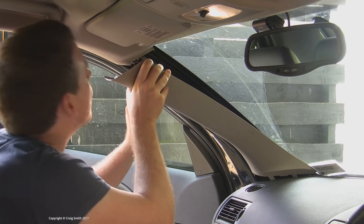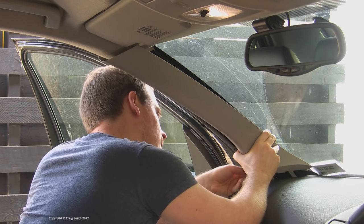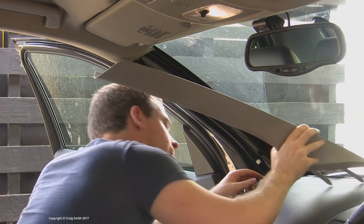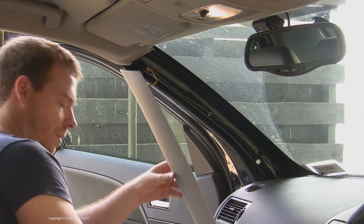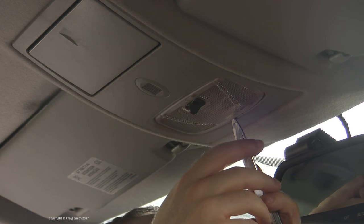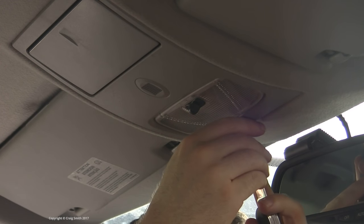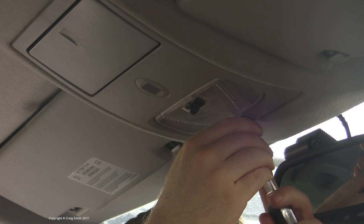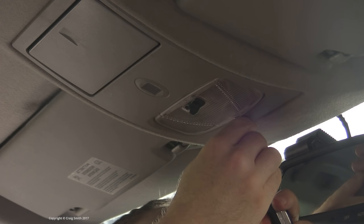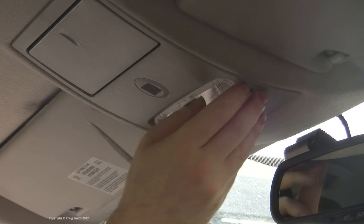So here this one's off, and if you look closely you can actually see the factory wiring running up there — that's the loom for the courtesy lights. I'm going to add my cable parallel to that. And I'm going to need to take my front courtesy light out, as I'll need to do that in order to stow away the USB adapter in the space generally available around its enclosure.